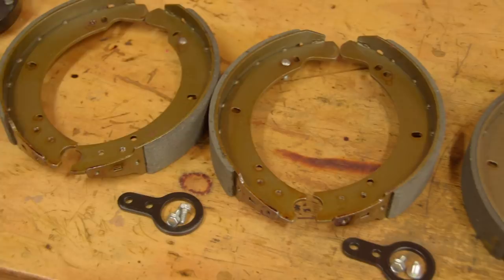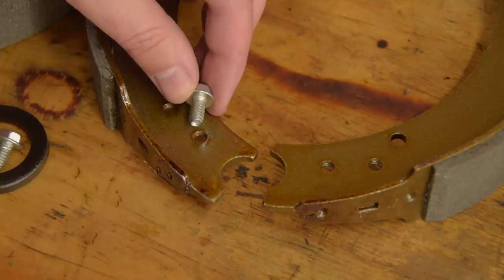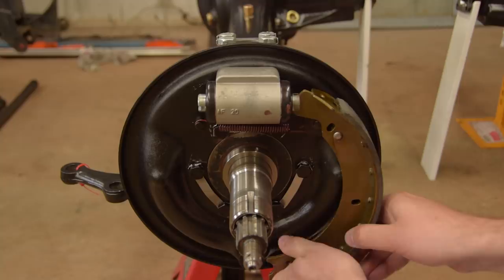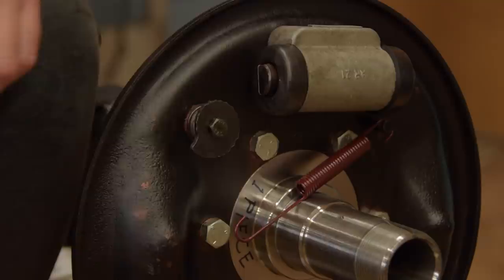These are new shoes, just generic ones — Britpart I think. I did order branded shoes with my parts order from the UK, but I ordered the wrong size. So if anyone in New Zealand wants a set of brake shoes for their 109, let me know. If you buy new shoes sometimes they come with self-locking screws in place of the old locking tab system — basically just a screw with an intentionally poorly cut thread. I never trust those so I'll be putting them in with thread lock. Instead of putting the shoes in place and then wrestling with pliers and screwdrivers to get the springs in, it's a lot easier to hook the springs in first and then lever the brake shoes on.